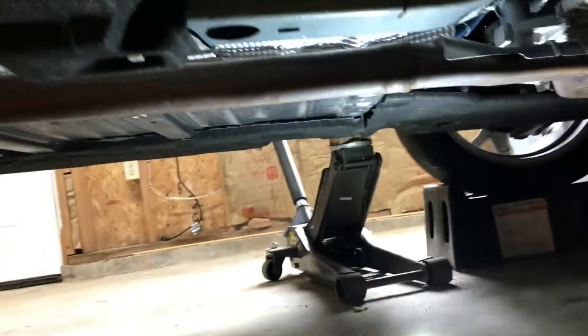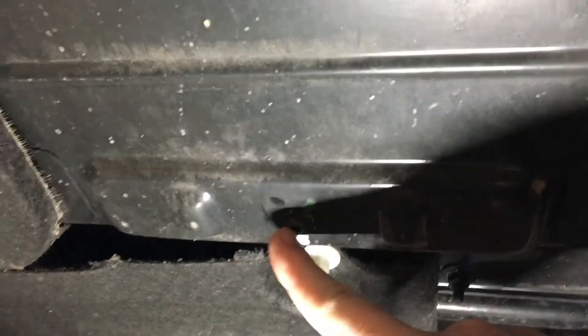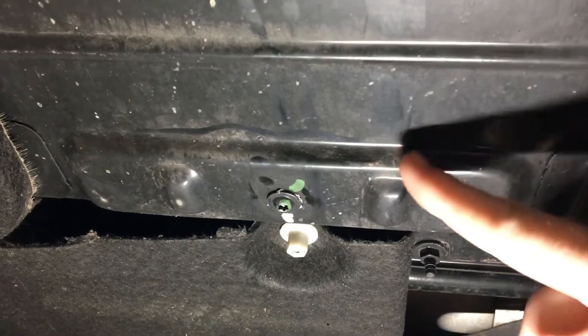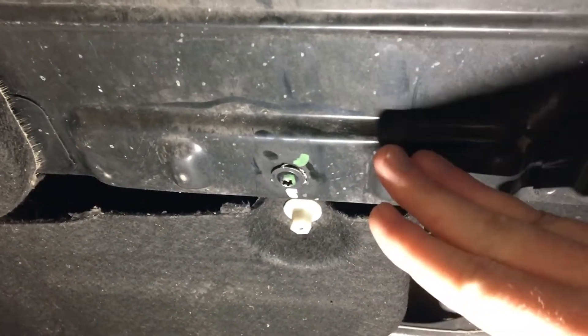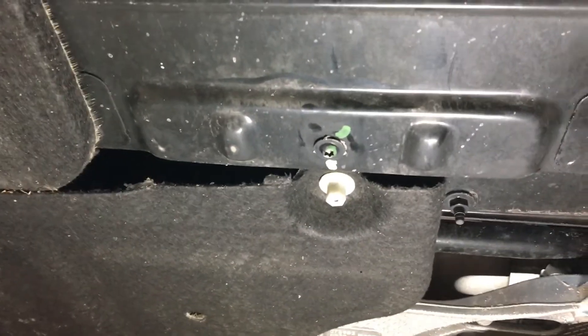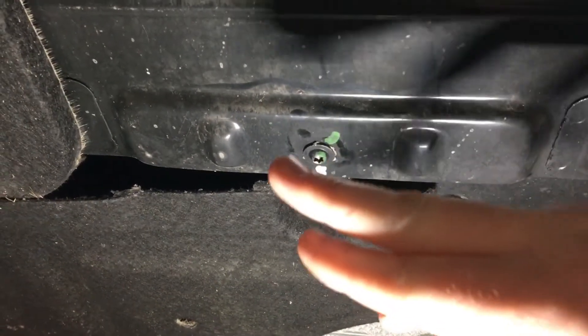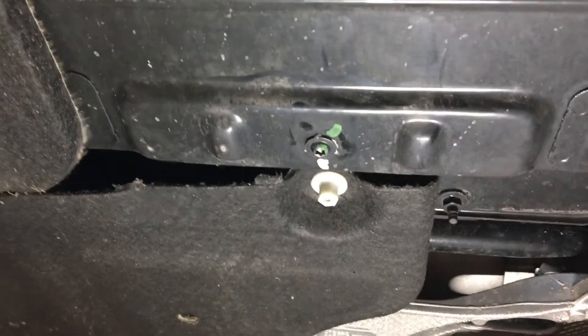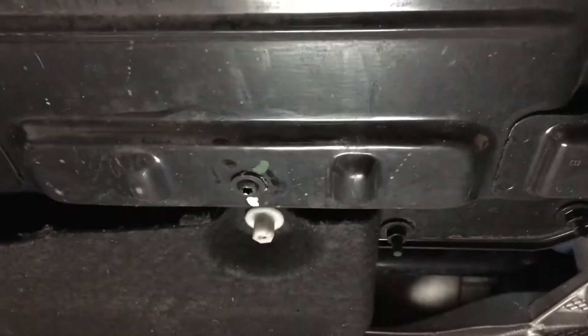About four or five inches back behind the seam of the door, if you go straight down to the middle of the vehicle, right here is a drain plug. This is all the battery pack right here, and this is the very front of the battery pack drain. In here is a little lowered section that's supposed to act as a drip pan — so if there is a leak, it will accumulate. You can pull this inspection bolt right here, which is a T30. If any liquid comes out, you know there is liquid inside your battery where it should not be. If nothing comes out, you should be okay.